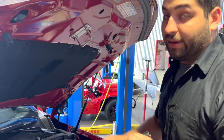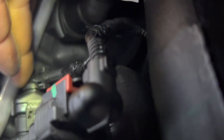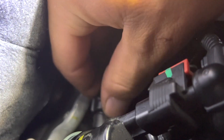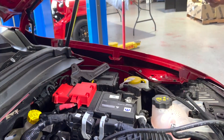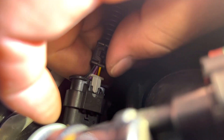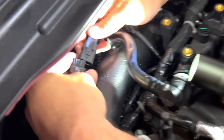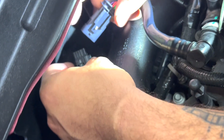Now we're going to go ahead and get our manifold absolute pressure sensor — it's going to be this plug right here. It's going to be underneath everything, a little hard to get to, but you can release this lock and it should come straight up. Follow this wire, take the same path, and get this down. Kind of feel for the sensor, then push it till you hear it click, and lock the tab. Now we can connect the OE side of the connector into our harness — flat side always needs to be down. Lock the tab.